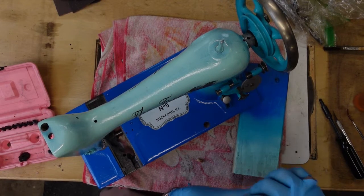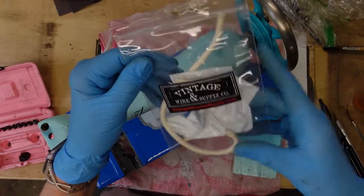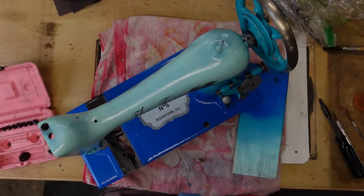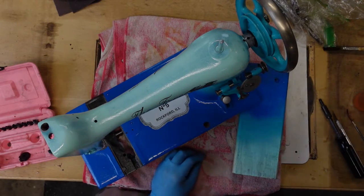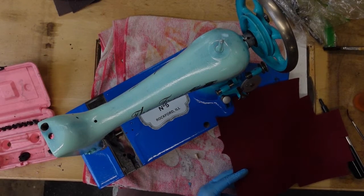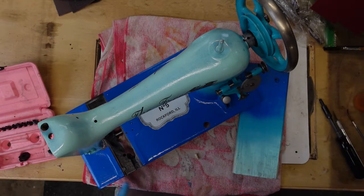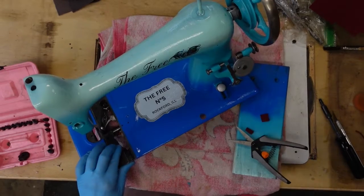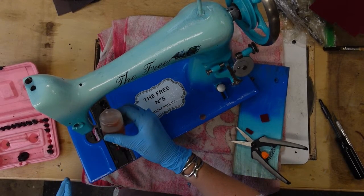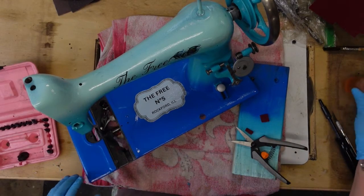I'm using oil wick material from Vintage Wire and Supply — I think it's actually for vintage fans; the old timey metal fans had oil wicks. I'm going to trim a little piece of felt, roll it up around that, and get it pushed back in here. It almost looks like a little flower because it's got the red felt around the white center. I'm just going to load it up with oil and let it do its thing.